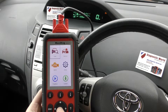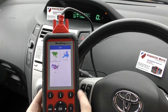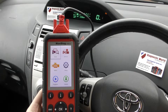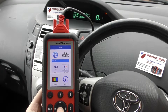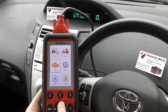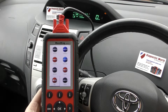We've got this tool plugged into the diagnostic port of the vehicle, so we're going to click on to scan. This tool does have a bit of a beep — I'm going to turn the beep off. It's entirely up to yourself whether you put the beep on or off; I prefer it off. We're going to click on to Asian because it's an Asian make, and we need to select Toyota.